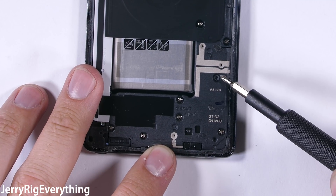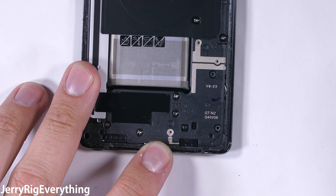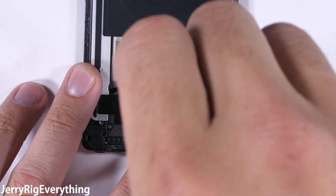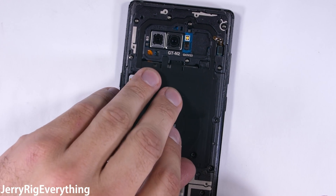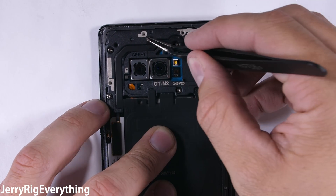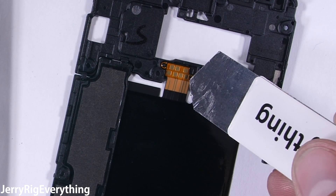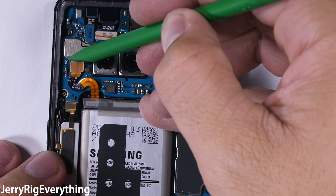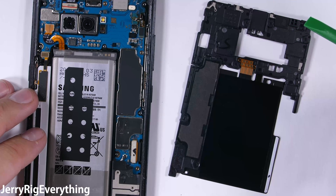The bottom of the phone over the charging port has 6 regular Phillips head screws holding down the plastic. I'll set those off to the side to keep them organized — I'll have a tool kit linked in the video description that fits these screws. The top plastics and wireless charging have 10 more of the same Phillips head screws. It's good practice to lay these out so they go back in the same hole they came from. The wireless charging panel unclips from the metal frame, and we can see the golden contact pads on the back that transfer power from the copper coiled inductor to the battery. I'm going to leave my wireless charging intact this time around.